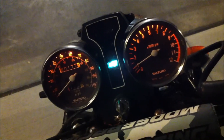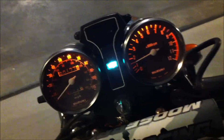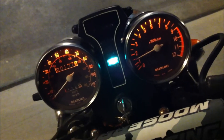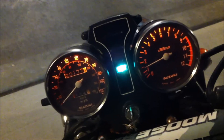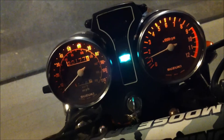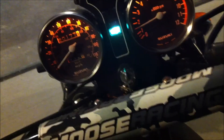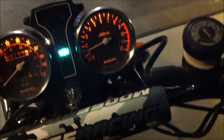I've got the second multimeter hooked up here, and I did check at 2,000 RPMs. It's supposed to be at 13.5 or higher, and at 5,000 it shouldn't go above 14.8. So let's just do a quick test. I've got both multimeters hooked up. I'm going to put it up to 2,000 RPMs — actually, let's start at the first level, the idle.